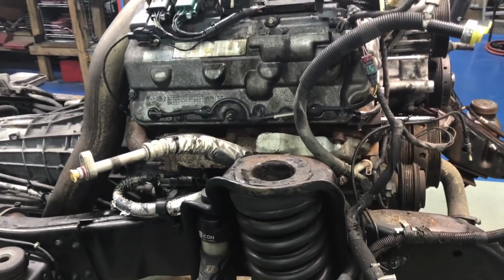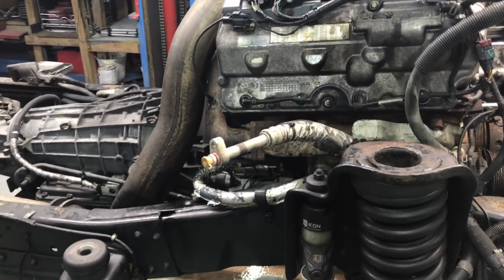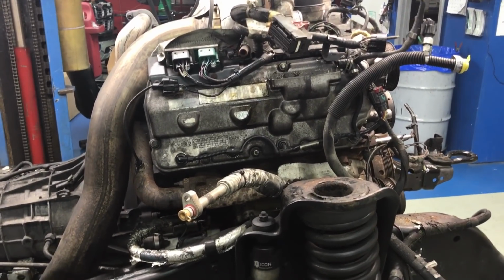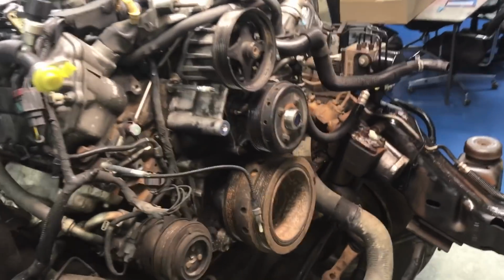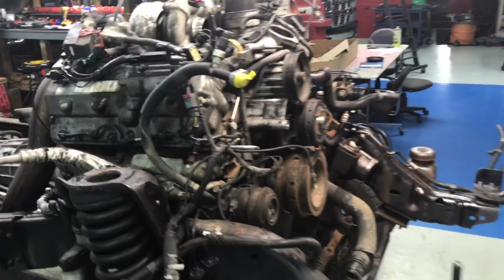And send off the pistons, fresh set of rods, ceramic coated, D-lip pistons, all that stuff, just everything. Let's try to make it last, make it work so he can lean on it. But he is staying with stock air, stock turbo, stock injectors, stock camshaft. If we're running that, I really don't care what tune you got. With a balanced rotating assembly with stock fuel and stock air, you can stand on it. Run it however you want.